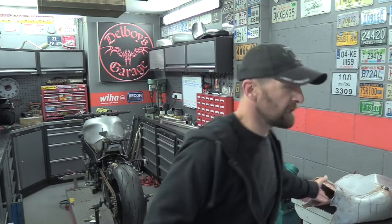I'm trying, if I can, to think ahead and design this so I can put an underseat exhaust, and the idea hopefully will be to bring it out the side, like torpedo tube style, at the side of the panel or possibly at the back. I don't know, but that's to be decided later on. At the moment, I can bring the downpipe that is there round the outside. I've discovered oval tubing exists, so I can buy that, weld and fabricate that into a piece and bring the exhaust up underneath. So that's why I'm not choosing to bolt it down from underneath. At the moment, I think from the top is the best way. Let's see how it unfolds. I don't know. So wish me luck. Let's do a bit of work.